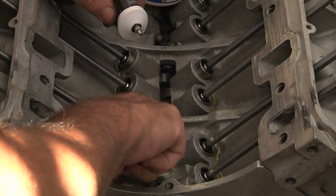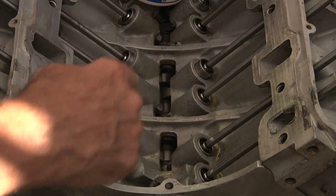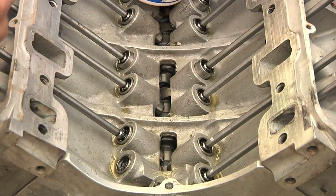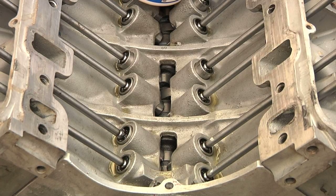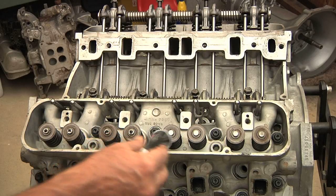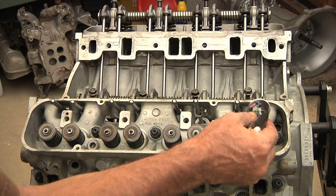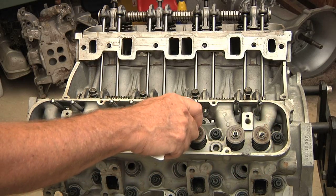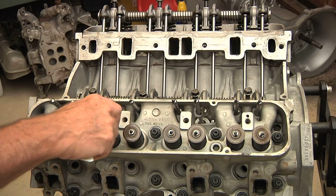Drop that in the orifice. Put a little lube in there, then drop in my pushrod. The first few seconds the engine's running, we will pump up the oil using the oil pump — it's already packed and ready to go. We want to make sure we don't scuff anything up, so I like to use a little assembly lube on everything.